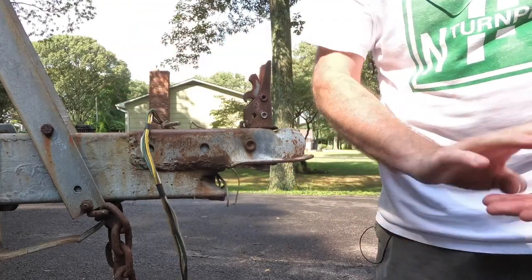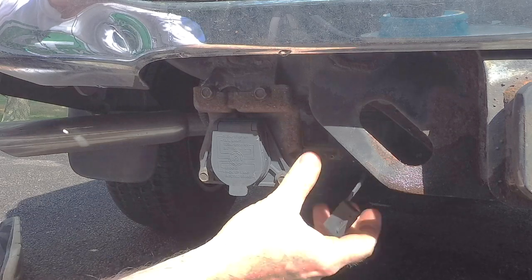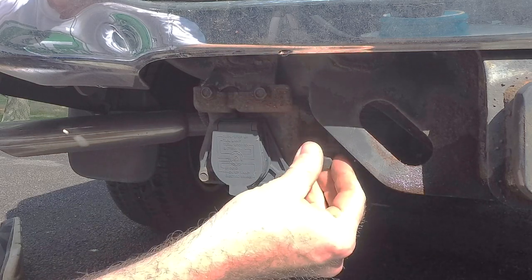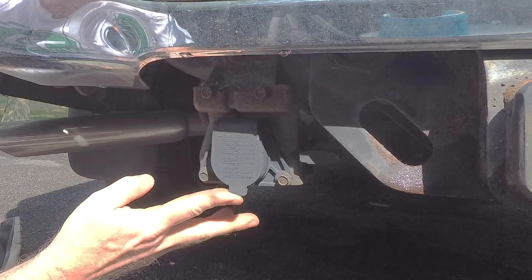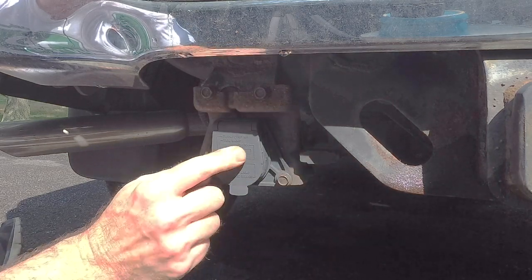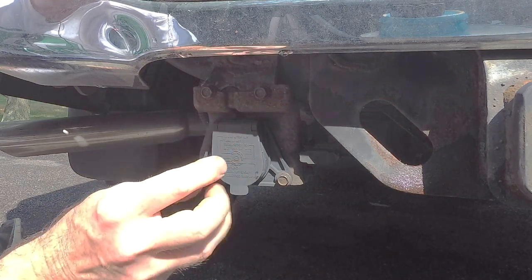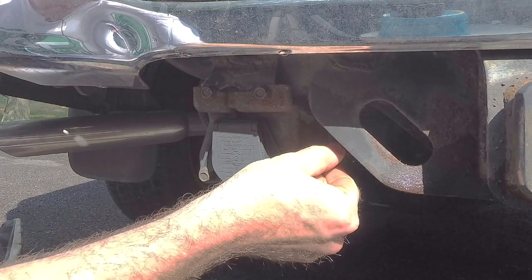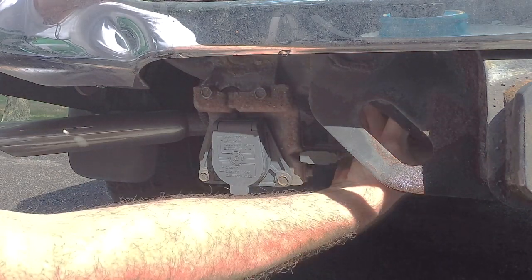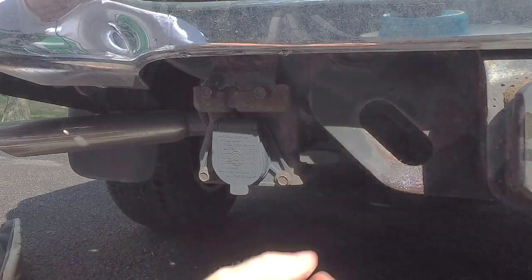Let's talk about the back of the vehicle. Common electrical connectors on a vehicle are your common four-pin connector right here — it has one that pushes on and then three receivers — and also this round-style connector right here. My particular setup has options for both. Some vehicles only have this and some only have that. See what your trailer has. If your vehicle only has the round style, there is an adapter you can get to connect it to a four-pin style. Sometimes the four-pin connector is wired up and tucked underneath the bumper, and you can find it under there if a receiver is installed on your vehicle.